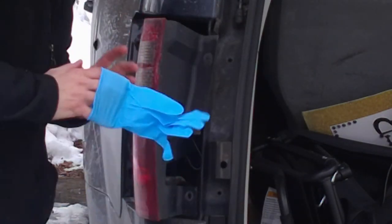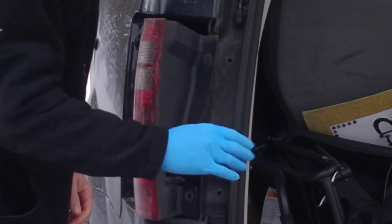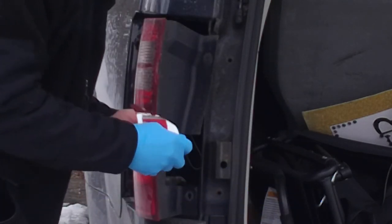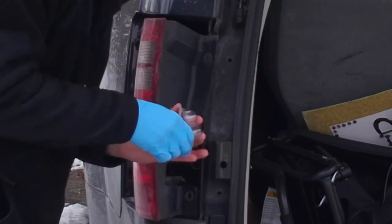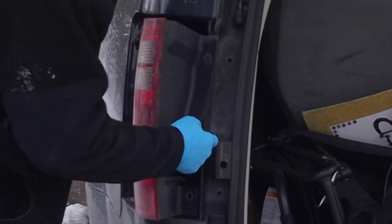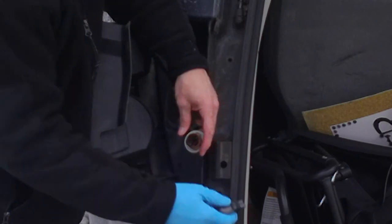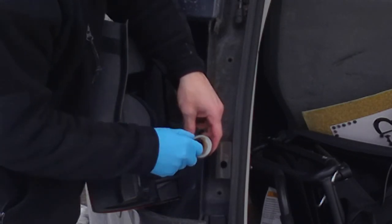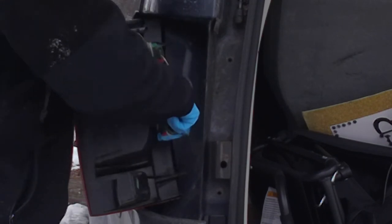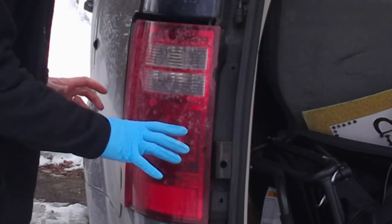To ensure the life of this bulb — the new one — I'm going to go ahead and put on a pair of gloves so that my oils don't get on the bulb. If they do, for some reason it can lessen the amount of time these are good for. So we're just going to pull it off, wiggle the bulb out, take the new bulb, slide it in starting from the bottom position, turn it up, and put it back in place.